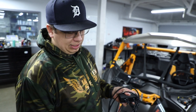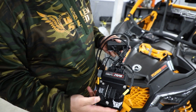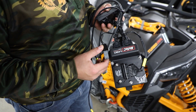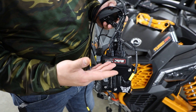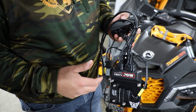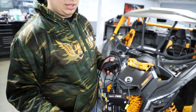A couple of other little things: there's an igniter. These coils are considered dumb coils so they need an igniter, and then this is a relay. This is actually for the factory fuel pump system. In the factory ECU, the ECU would ground the pump, but it's kind of crazy to ground a fuel pump, especially when we put bigger ones in that have more amp draw.